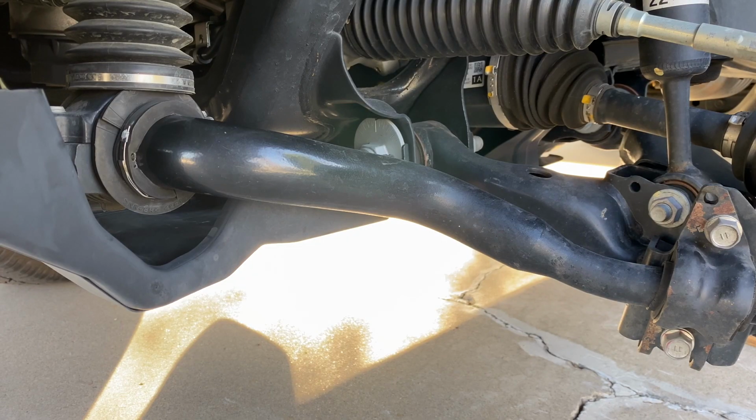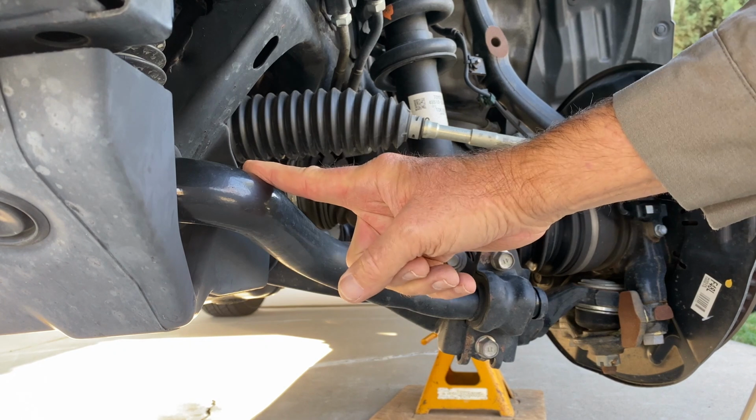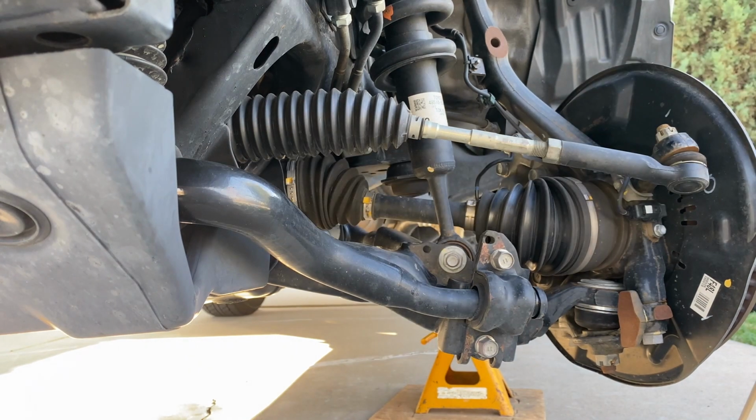And it also has bearing for something like having a rooftop tent or other roof-mounted load. If you have more roll stiffness down here, you can tolerate more load up there. The increase in roll stiffness isn't quite as massive as it looks. I mean, this is a much bigger stabilizer bar than what you'd see on a standard Toyota 4Runner.